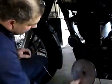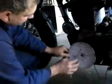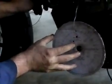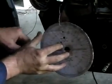I printed off a timing disc from the internet, attached it to the rotor nut. It had a wire — it gives you the idea of what I did. I didn't have time to film it when I was actually doing it. By using the top dead center tool and rotating the engine back and forth, I found exact top dead center by going to the halfway mark of those two extremes. I knew it was exact top dead center.